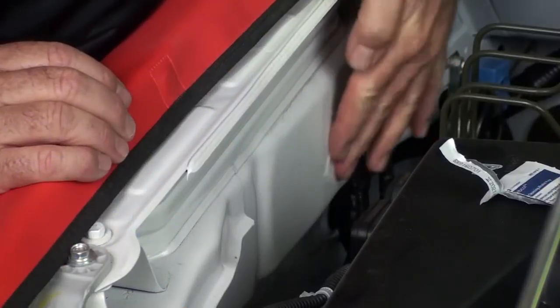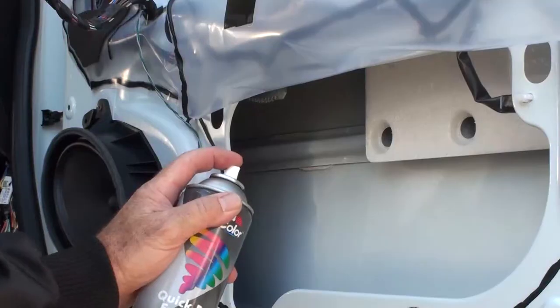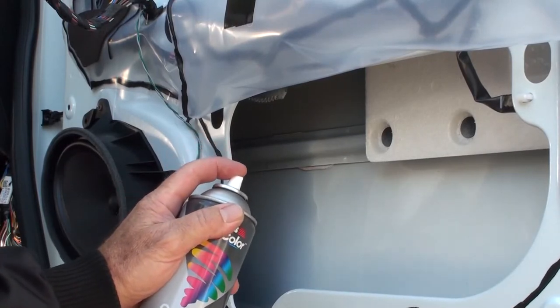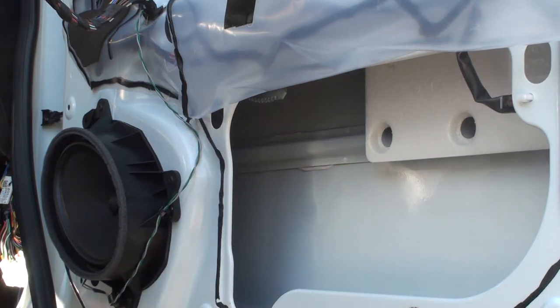Coupler sites must be thoroughly cleaned. Please note the coupler site must be well painted. Most vehicles have sufficient paint in the engine compartment, but not always in the internal panels or rear compartments. If in any doubt, apply two coats of quick dry enamel to the coupler site approximately 15 minutes apart using an aerosol can. It is only necessary to coat about 200mm square.